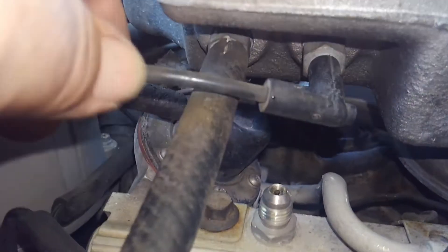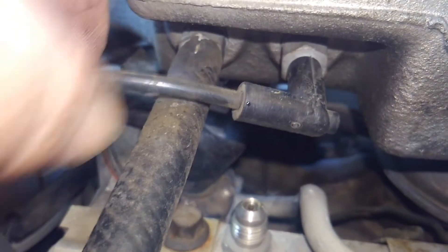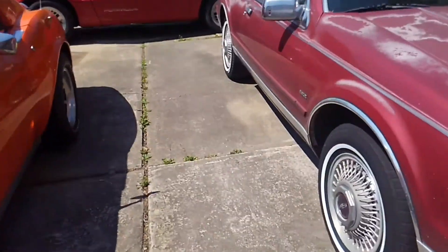That controls the opening of your EGR valve once you go into closed-loop operation. When these tune ports first start, they run basically open-loop until the engine warms up, and then they'll go ahead and start letting exhaust gas recirculate back through the system. Essentially it's a very fancy choke for the tune port injection using vacuum tubing. One problem with this vacuum tubing is that it becomes brittle over the years — I'll talk about that in a few minutes.